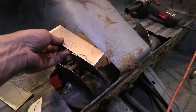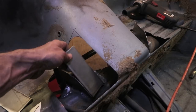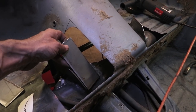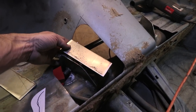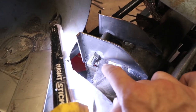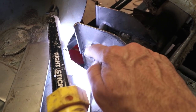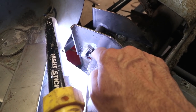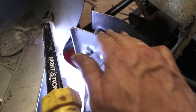I just cut these plates with the plasma cutter. They are going to go on top of this now that these pieces are level. I'm going to start down low and tack it in near the torsion tube, and then weld and bend it as I go and sort of shape it so it meets these plates, then trim the excess. If you notice right here, this is the factory gusset — it's been trimmed a little bit. The uppermost hole here is interfering with this gusset and I really can't get my wrench on there. So I need to trim this back just a little bit with my cutoff wheel — I'll do that at the same time when I grind the top of the welds off.